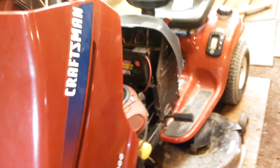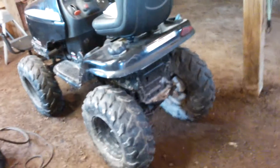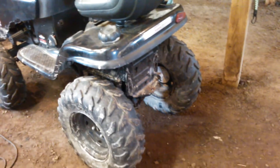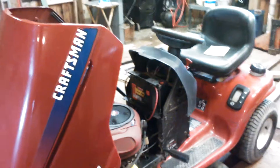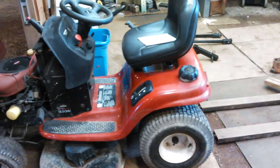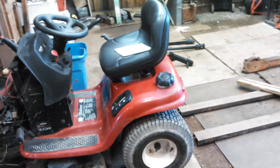I've got to rebuild this thing completely — tear it right down to its bare chassis and go through and rebuild it. You wouldn't believe the benefits that welding in a subframe gives you — tons of benefits. On these mowers I've been off-roading for quite some time. I usually move the transaxle back by about two to three inches, and I leave the stock pulley as well. They do go a little bit faster than stock because of the stock pulley and the bigger tires, but not very much. This back transaxle sits too far forward, and when you try to go over any obstacles your front end likes to pick right up. That's one of the dangers in lifting them — if you lift it, move your transaxle back. That's one of the things I developed.